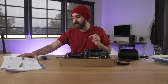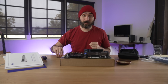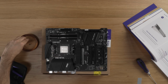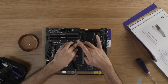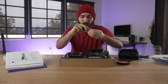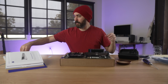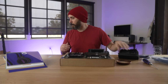You may need to skip this step if you have an M.2 shield and removed exactly 2 screws on step B, which is what I did. So I'm gonna skip that step, and then just screw it back in, which I believe this thicker screw is on the bottom here. Thank you, dog. That's snug. And that's snug. Okay. That's it, level 4, here we go.